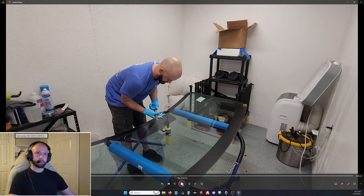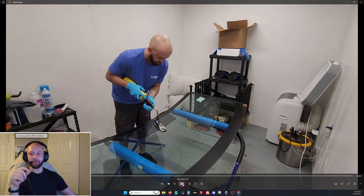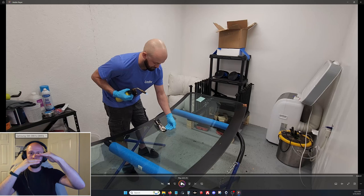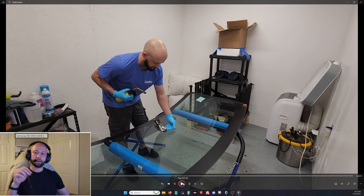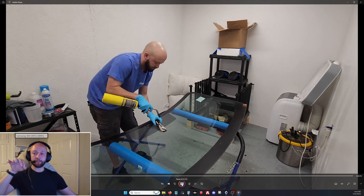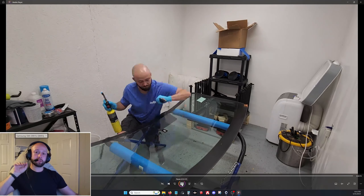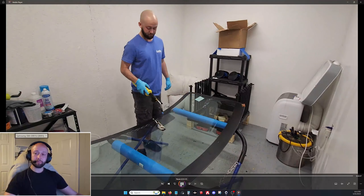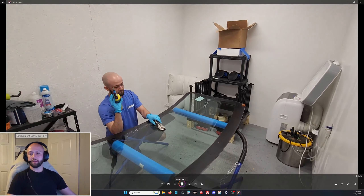We're going to start by taking the rear view mirror buttons off. Use heat from a torch and take the vice grips with the jaws almost touching the glass — about a sixteenth off — parallel with the glass. Apply heat to the top and bottom gently; if you heat the glass up too quick you'll bubble the laminate. Gently wiggle the vice grips, keep force parallel with the glass, or you risk chunking it out. Rinse and repeat top and bottom until you wiggle it off.